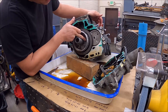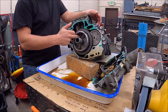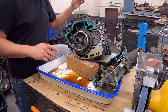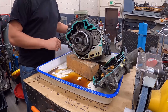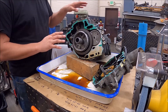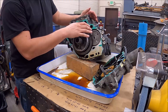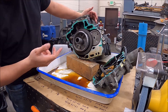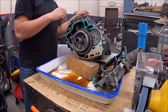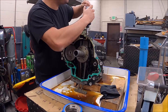These are the dreaded flywheel bolts that everyone talks about — the ones that come loose or shear off. That's definitely a must for replacement; you've got to put aftermarket or new ones in. They do break and have had problems for years. I use ARP ones, or Aqua Sport which are still ARPs just rebranded — I've never had a problem with them. Now we're getting into tearing apart the lower bottom end of the motor: we'll get the Bendix out, stator magnet off, flywheel, counter-shaft balance, timing chain, then flip it and get the case apart.